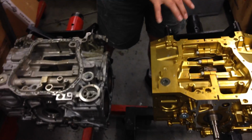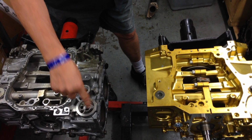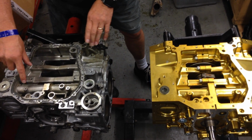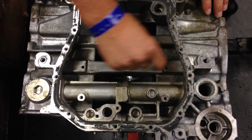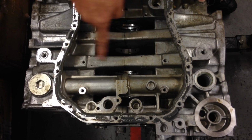and now we're looking at the underside, and of course this is where the sump is. So the sump normally sits on top of here. You have the oil cooler assembly with the oil filter, and sits on top of this. And just look at the amount of material in here, and this assembly here, which is the web and the crankshaft, sits down in between these castings here.